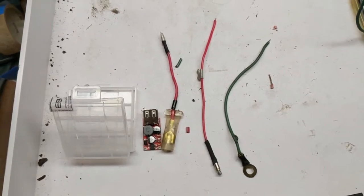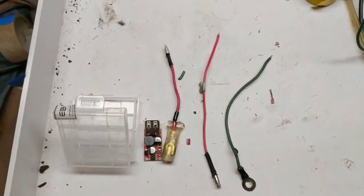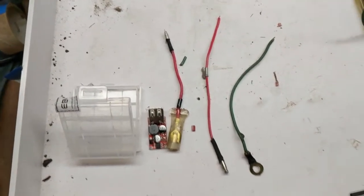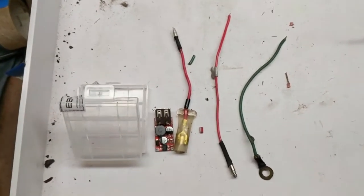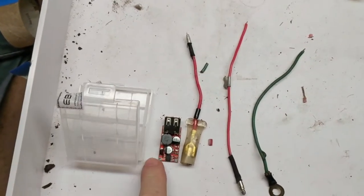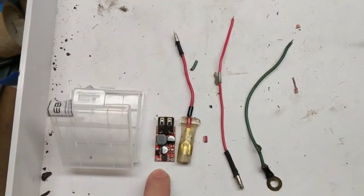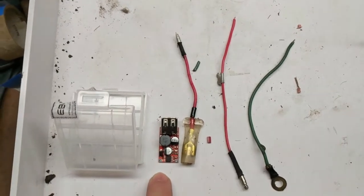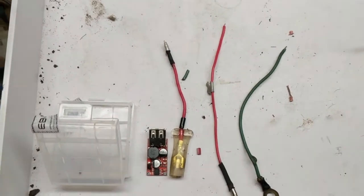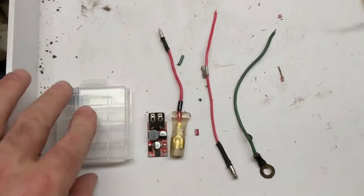Here is our parts list for this project of putting a USB capability into a Honda CT90 or similar. The wiring colors I'm talking about are correct for a Honda CT90 1970. I'll put a link in the description — it's from Amazon, it was $8 or something. It's a 5.1 to 40 volt input USB output little module. The wiring I've taken from an old CT harness just to keep things tidy.